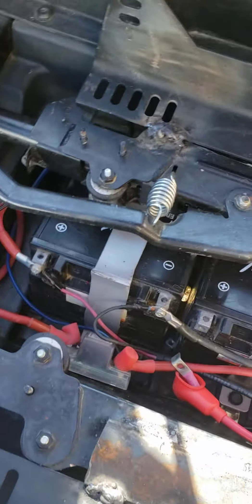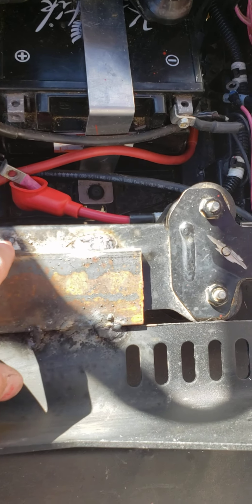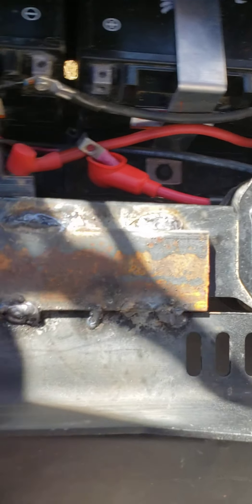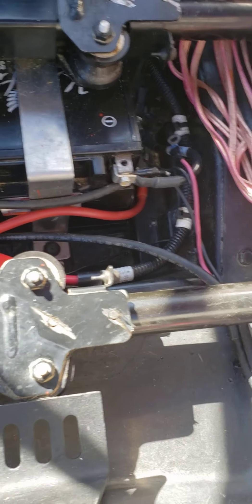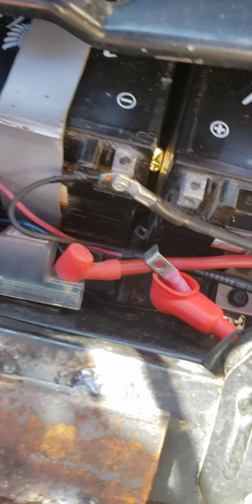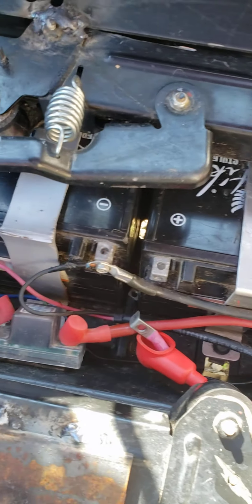Here's how it finishes off — it's pretty easy. Just put a plate, weld it to the slider, which slides back and forth. I still need to put a piece of trim in it to hold it down. On the other side, we cut off a couple little L-brackets that were there from the factory, put this flat piece in, and welded it there on both sides.